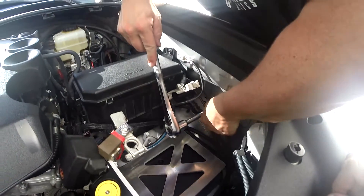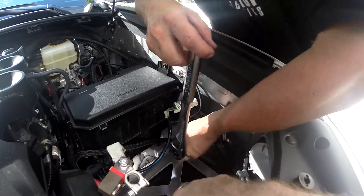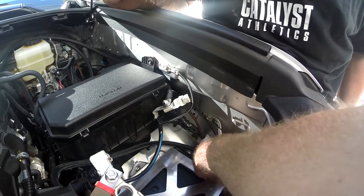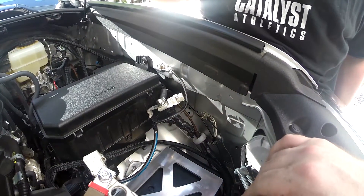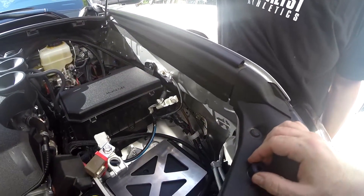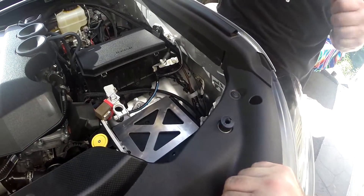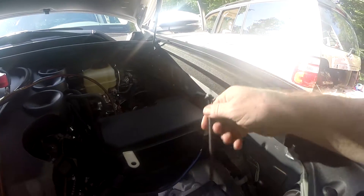The leads running from the MLACR to the switch inside the cab have also been run inside these brackets along the way. A few more zip ties and we'll have everything snugged up. We're ready to drop the battery in — we wanted to show you all this before the battery went in, so we're getting pretty close.